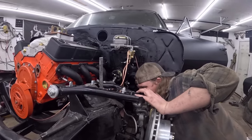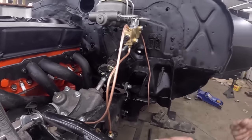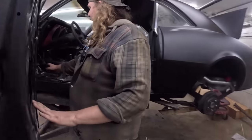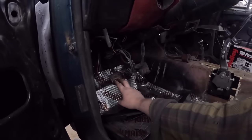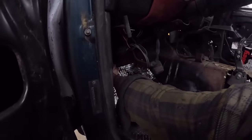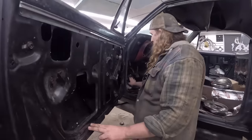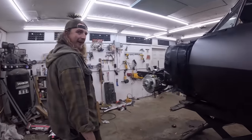Yeah, it feels like it's getting close. I may have to take that apart so I can do it by hand, but hopefully we've adjusted it some. Yeah, so now right here is where it's starting to grab. So that's not terrible. And then right there is where you really feel it. And that's the clutch going all the way in. So I'll probably put a little bit more in it. And we should be fine. And hopefully I won't have to take it apart again.